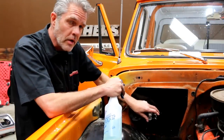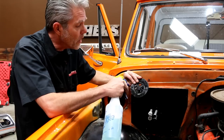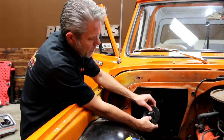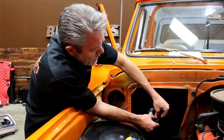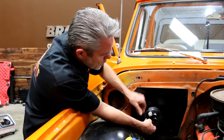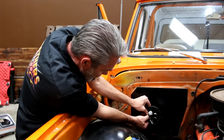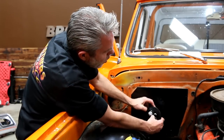We've got this on here. I'm not tightening up my bolts just yet because we've got to put this grommet on — I'll use a little bit of soap on it, slide it over, and then we'll be able to tighten it up. When I tighten it up, I'm not going to grab one bolt and tighten it all the way down. I'll snug them up first and then slowly go around and tighten up each one so that we don't warp our plate.